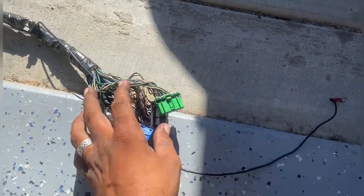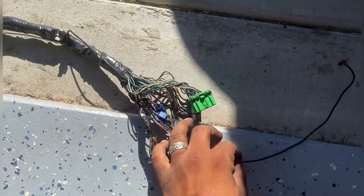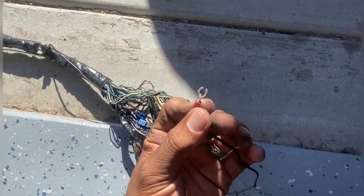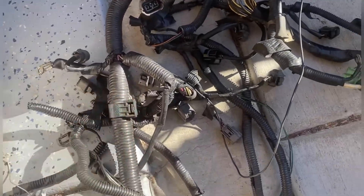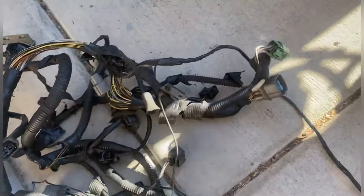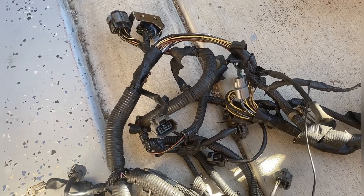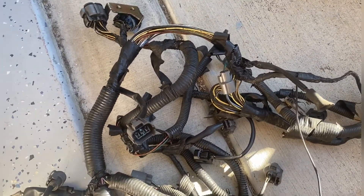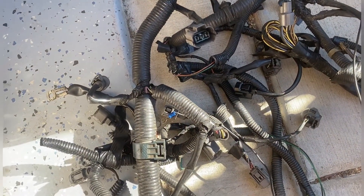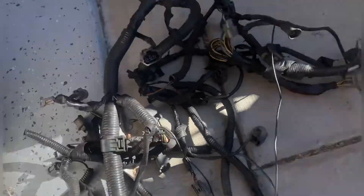Here's my old harness. It's in pretty good condition. I think we just modified my Civic CX harness to make this one — that's why we had to add things in. There's a ground here I'm not sure what it was for but it was important, so that was bolted in. As we come down the line, all the standard plugs. Things had to be added, like an oxygen sensor, because this car first went to a D16 Y8 from a Y7, and on the Y8 the secondary O2 sensor is part of the cabin harness. We also had to add a plug for the IABs.